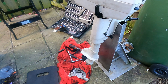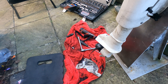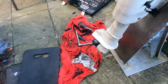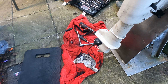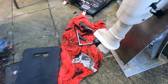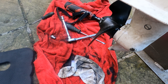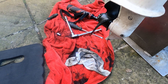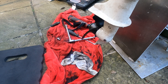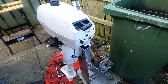Just a quick test to make sure the gearing is working. Got the engine on the stand — pull the prop and you can see it's not turning. Click it into gear — that's turning, so the prop's working. Back to neutral. Sometimes these ones take a little bit to come out of gear because it is spring-loaded. We haven't got the weight of water or resistance, and normally the drive shaft turns at a higher speed, so I'm quite happy that it's working. It's just a case of a test run once the gearbox oil's in.